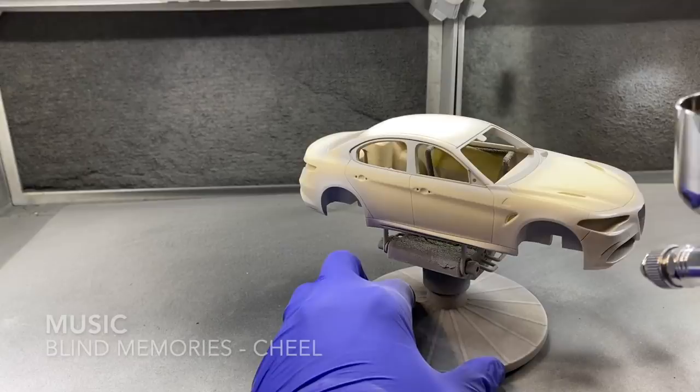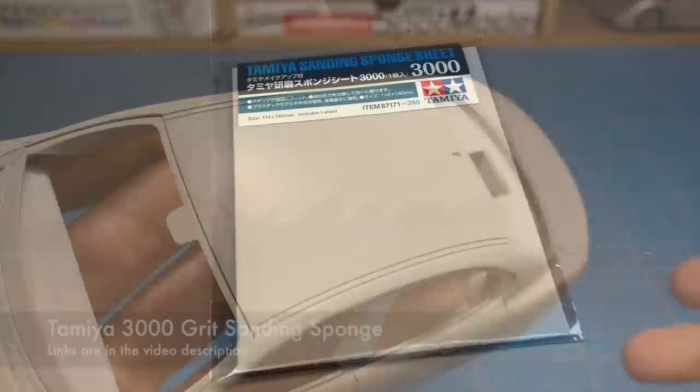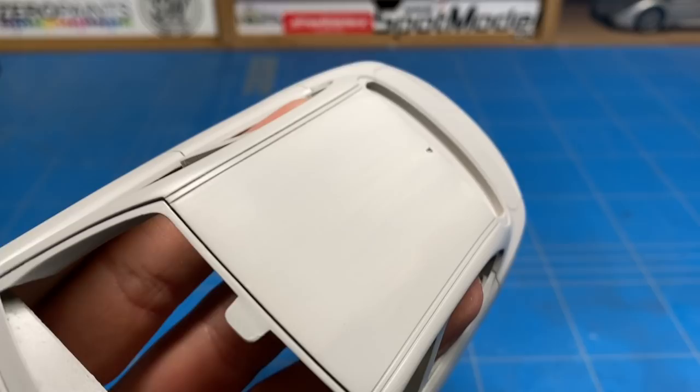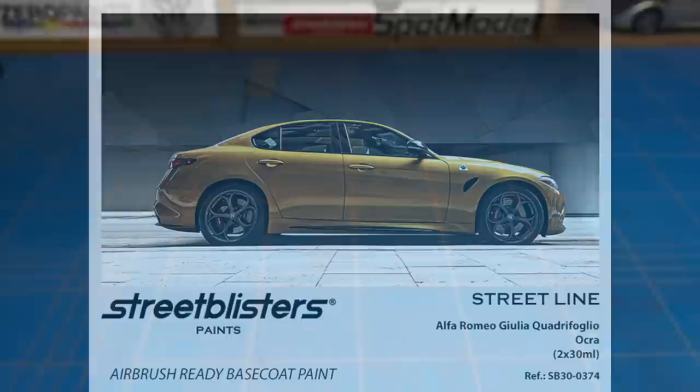After applying the first coat, I let it sit and cure for about 10 to 15 minutes and then applied a second coat. Once that was completed, I let that cure for about an hour and then moved on to sanding it smooth. There was a little bit of a texture in there, but not too much, but just enough for me to notice and not want it there. So I took some 3000 grit sanding sponges and sanded it all nice and smooth